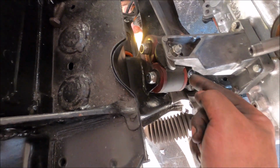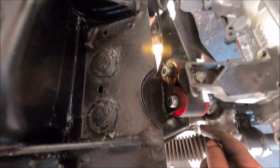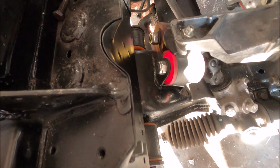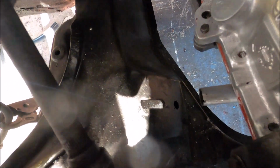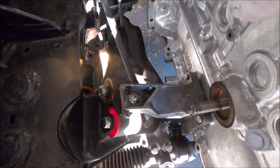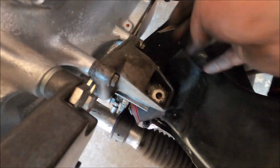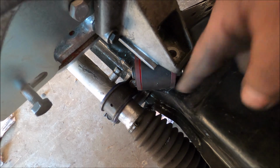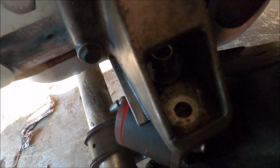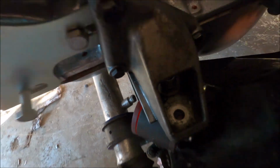Engine mounts are Skyline ones with a little modified seat thing on the subframe. That's the OEM mounts for MX-5 on the subframe there, by where the turbo oil return is now. Much the same on this side. That's the standard mounts. That's a standard Volvo one. That is a Skyline rated engine mount. And again, that's the original hole. That's a re-drill too, further back.